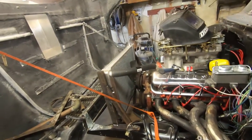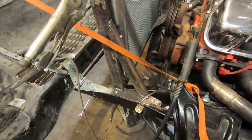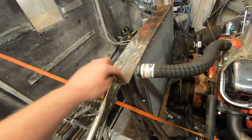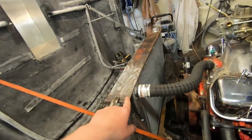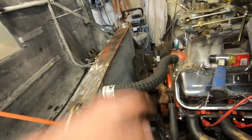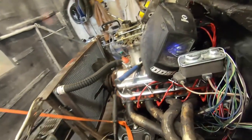Working on the rad support - it's not going quite as nice as I was hoping but it's all scrap steel. I got my frame there, bolted down both sides, and ended up putting a strip across the top. It actually has a little plate that sits in the radiator so it can't move back and forth. I've got it clamped on for now - I'll clean the edges up and put a nut and bolt on each side. I cut the hole a little too big for the cap since I didn't have a big enough hole saw. Once I put rubber across the bottom and top it should stiffen right up. I got one universal radiator hose on and need to work on the bottom one.